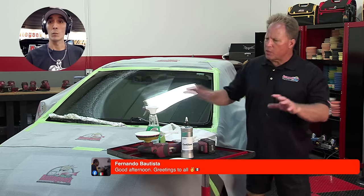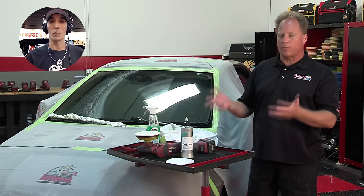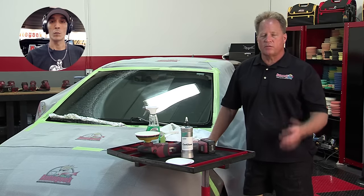Anybody that's taken a class with me, watched anything I've shot in video or read any of my articles knows that the two words I talk about the most are abrasive technology. There's good stuff and there's bad stuff. I can't tell you how many times I've seen someone say, "I'm having a hard time polishing the paint out of my car. I'm removing the swirls and scratches, but it looks funny." The reason it looks funny is because the stuff they're using is cheap and it's micromarring the paint, and you're making the clear coat less clear. You might remove the swirls and scratches, but now you've got micromarring. It all comes down to abrasive technology.